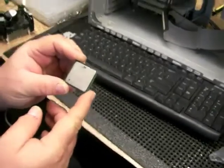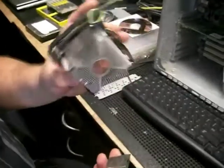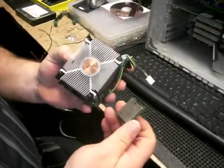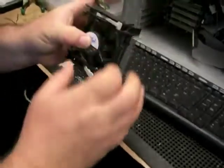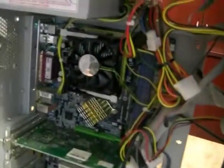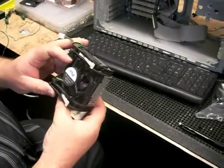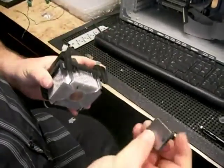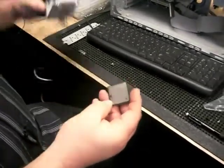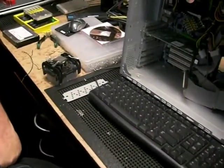Of course it gets very hot, so this tiny device requires a big heat sink. That basically glues onto the heat sink, and the heat sink and cooling fan is what you see inside the computer system — that's what keeps that little fellow cool. If your fan blades get clogged up with dust or seize up because the bearings go, then it overheats and starts causing data loss. So a bit of dust in the fan could be the cause of trouble — a good clean-out might fix it.